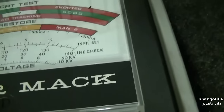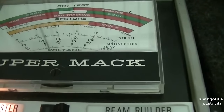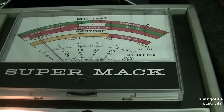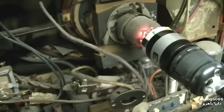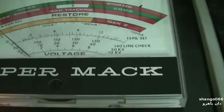Let's check the CRT. That's a good sign, but the thing is baked, man — I just don't see it happening. Bring the filament up to where it's supposed to be. Let me let it run for a minute; I don't have high hopes for this. This is why I say don't ever buy a television unless you are able to check the CRT first. Because if this is dead, this thing is junk. Well, surprisingly, this thing has actually come up. That's the cutoff and that's the emission. We'll do the life test on it — it'll probably be pretty bad.